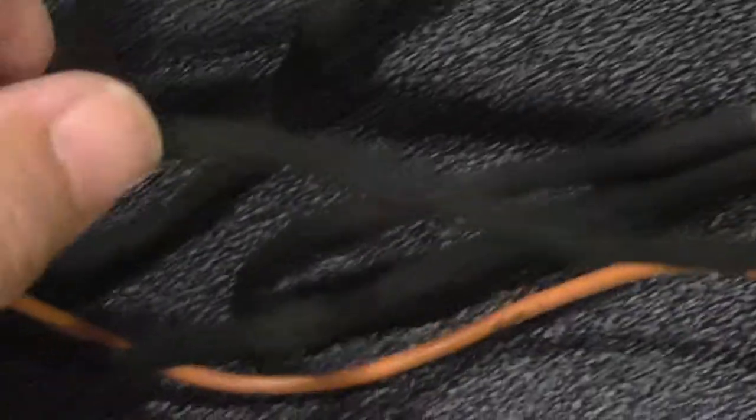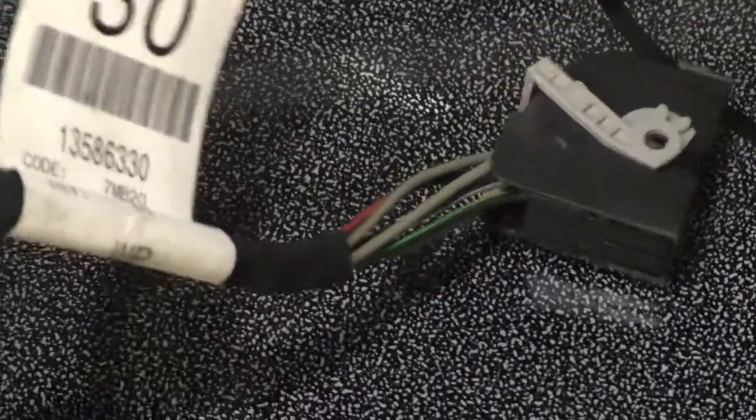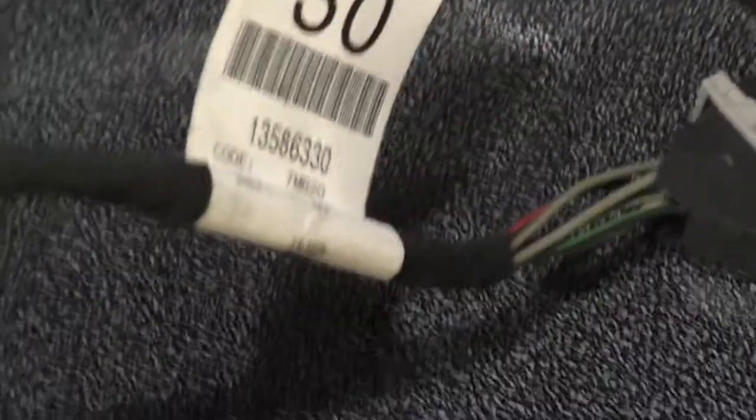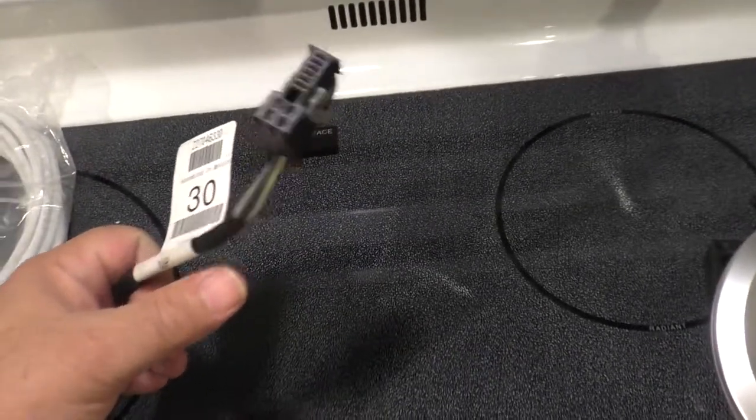This is part number 164-440-6434. But the distance in this harness from the grommet that comes through the outer shell of the vehicle to that signal acquisition module is quite short. You can see the length is just from the grommet here following to this end here. It's about a foot long, because in the donor vehicle that donated this harness, the signal acquisition module is right inside the shell of the vehicle, just inside the vent. So this length needs to be about 4 feet longer to reach the new location of the signal acquisition module under the rear seat.